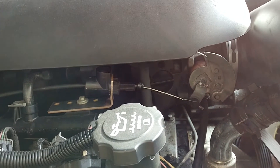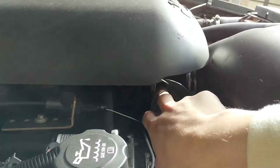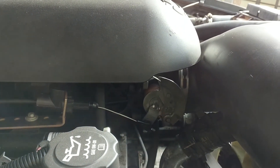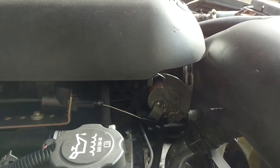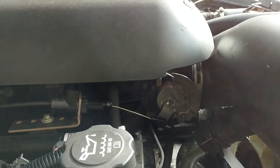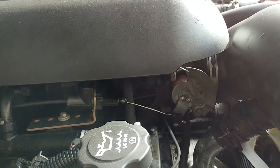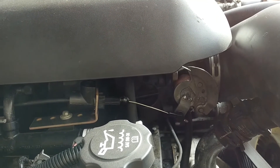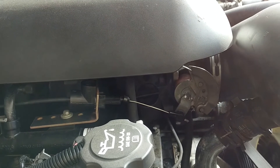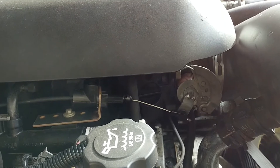To adapt the TV cable to work with the LS throttle body you need to use a drive-by cable throttle body for the engine. There's a way to do it with drive-by wire but it's too expensive and complicated when drive-by cable throttle bodies are a dime a dozen. The right way to do it is to buy the adapter kit from Bowtie Overdrives, but if you're like me and you don't have the time or money to put in a 4L80 or 4L60, you probably don't have the money to sink $250 into a kit for your outdated transmission.